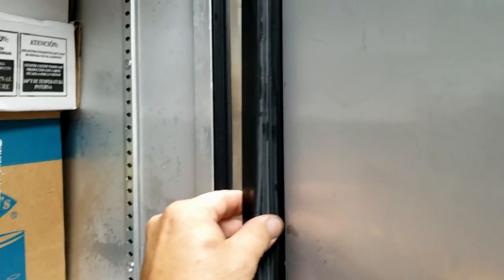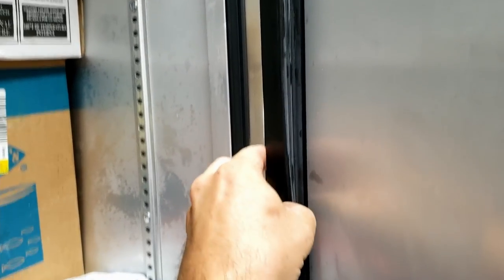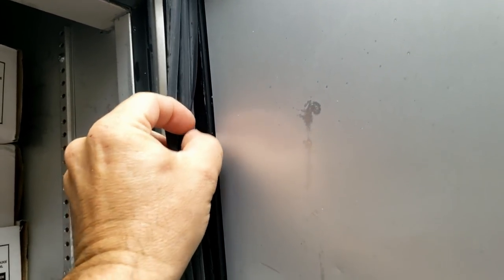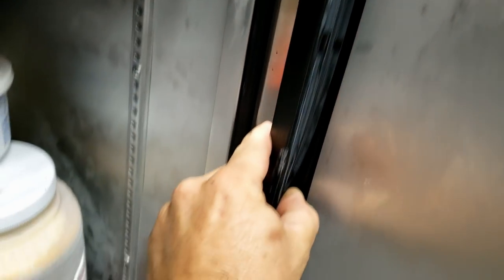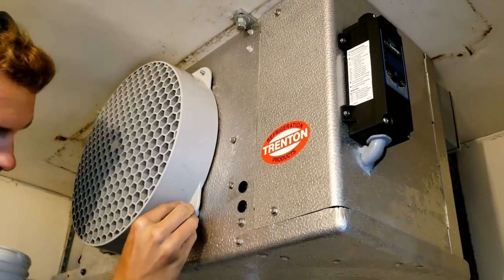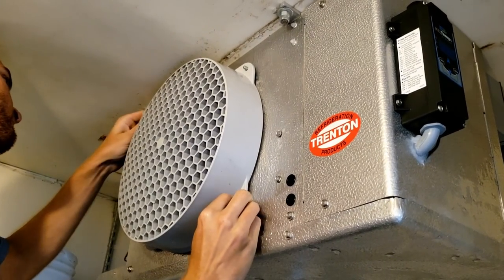They also wanted us to check out the freezer here. What was happening was the door seal was sticking and rolling the magnet, causing a gap which then had a bunch of frost. I ended up yanking the door seal off, threw it in the sink, got it nice and warm, was able to roll the magnet back to flat position, and then put a little silicone at the edge corners so it'll hold there and won't roll in place again.